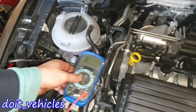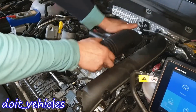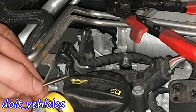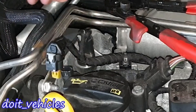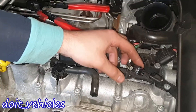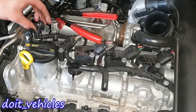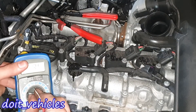We're gonna do some testing with the voltmeter, and this will slide out. Now we've got access to all the sensors, so let's disconnect them. We've got this safety clip — just pull it up and then the connector should come out as well. Notice that this is a 3-wire sensor since it's a classical camshaft sensor, and then we've got these with 2 wires.